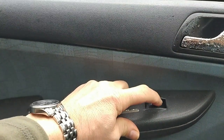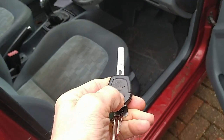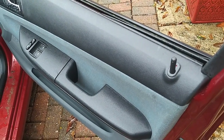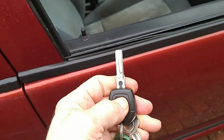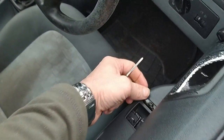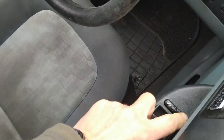This has happened to me before, a few years ago — when it's really damp, they seem to have a mind of their own. The key's working alright, but the indicator's not. Just shut the door a minute, as that can jiggle the wires and connections going into the door on the A pillar. Now the indicator's working. Still the windows don't work — that could be down to the moisture dripping through the switches or the contacts coming loose.